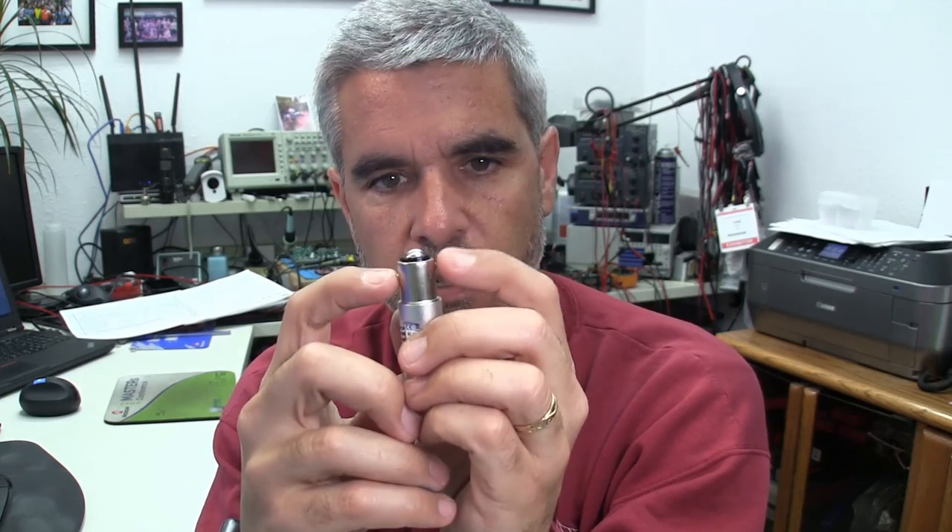I'm not sure in my case I want that spotlight effect. It looks like this doesn't unscrew — it's pretty solid. It has the standard offset tabs, two positive contacts, and the outside is negative, which is how it has to be for an LED to work. Let's take a look at what this looks like installed on my trailer for the rear brake lights, and how bright one side is versus the other.